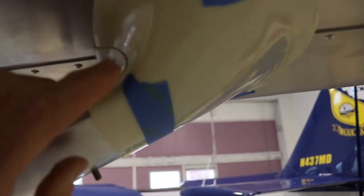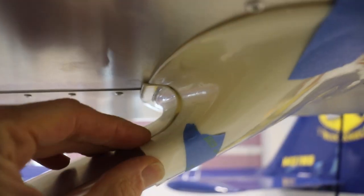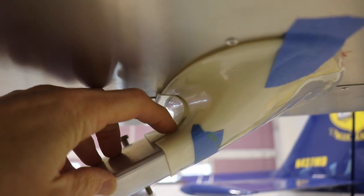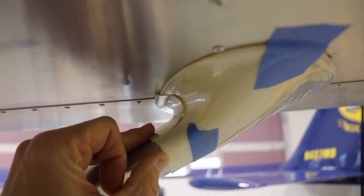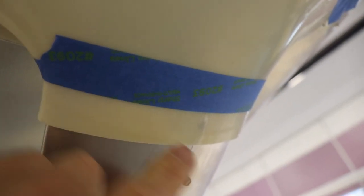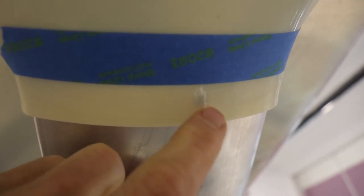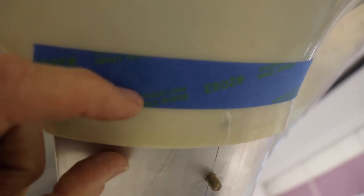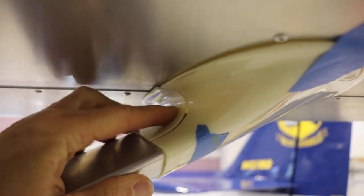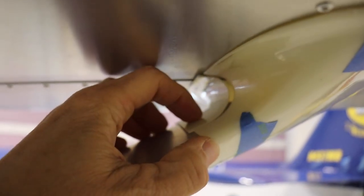Change of plans. Right after I filmed that last clip I was going to trim it, but I looked at the top side and if I continue this line over there's just not a whole lot there. I'd rather have this come down further over the strut. So I'm going to move this tape down, and on the bottom of the fairing I'll cut out a half circle - that will let it go around the bolt so more of the fairing comes down over the strut. That gives me a little bit more coverage.